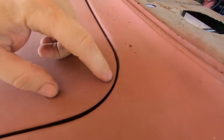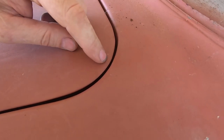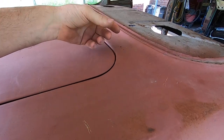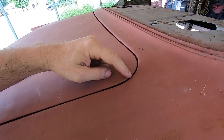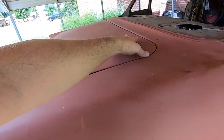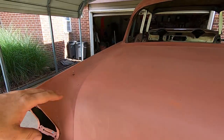You can tell right here — this is just factory the way it's folded. It's really tight in this little spot right here. So I'll go in here with a roll lock and open this up a little bit, and it usually separates the folded bottom and the top from each other. So you'll have to go in there and tack it back together and then grind it again. But that's the way to get a good, nice line.